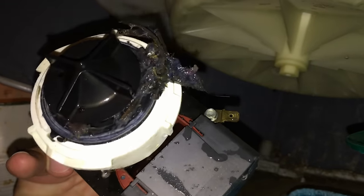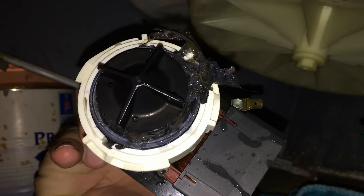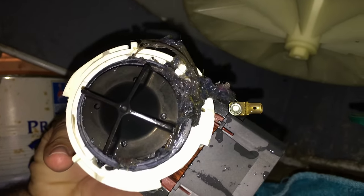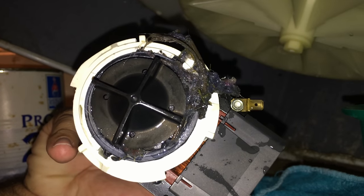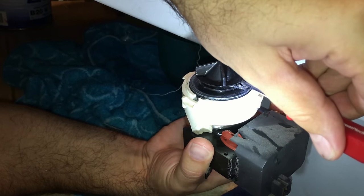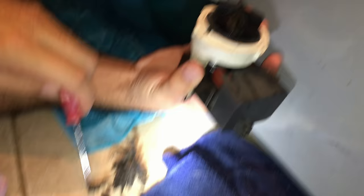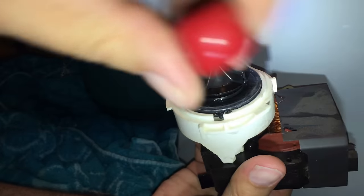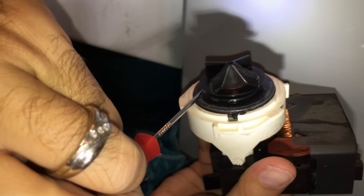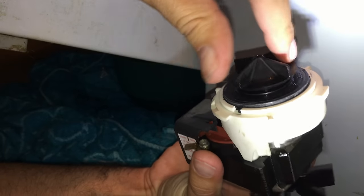Yep, and that is the reason the pump was not pumping water out — that's what can happen over time. I'm using this little pick tool to get in there and really remove a lot of this nasty gunk. That's what I pulled out so far and I'm not done yet. I think it's totally free and clear now, nothing left, and it spins freely, so I don't think I damaged the motor.